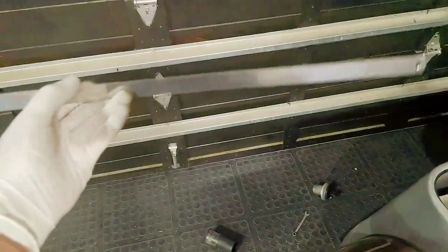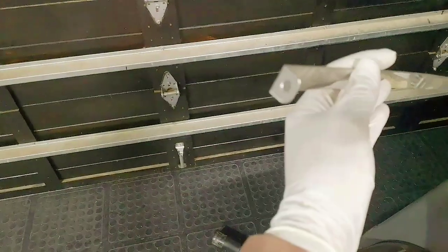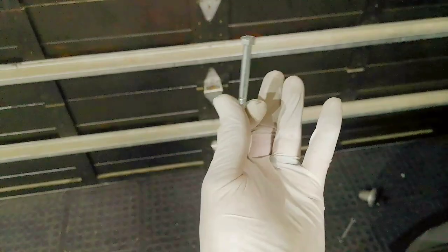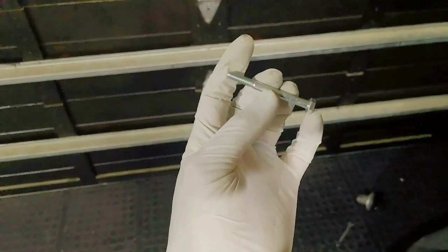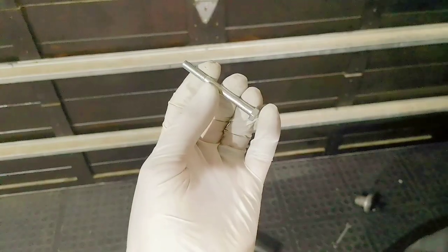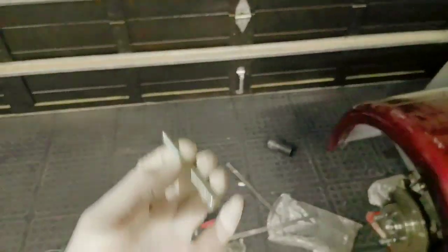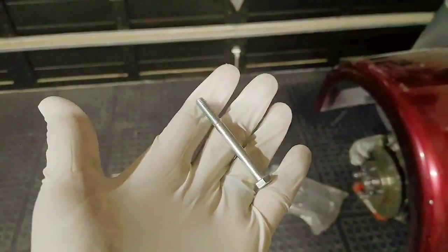They look like this. Attach the top first, because when you get to the bottom over here, they've got fairly long screws, looks like these, and the idea is that those will then brace the fuel tank. So these are adjustable and you'll strap the fuel tank as tight as it needs to go. We also do have some rubber strapping here to make sure that we don't damage the fuel tank and that it can actually handle the stresses that are going to be put onto it.